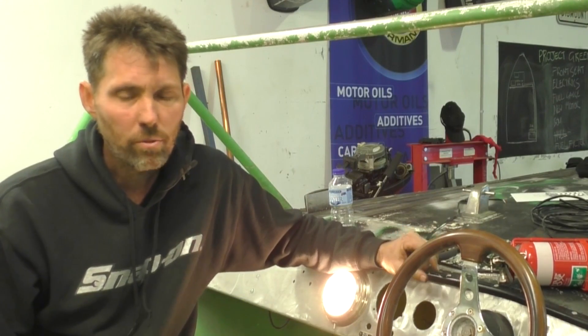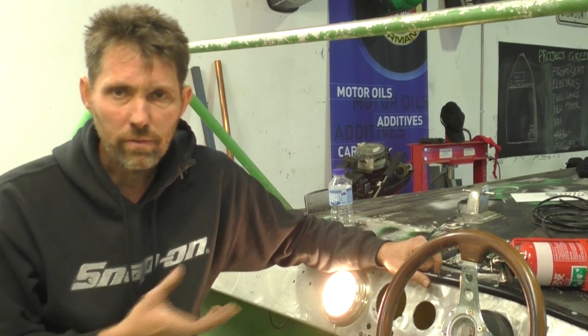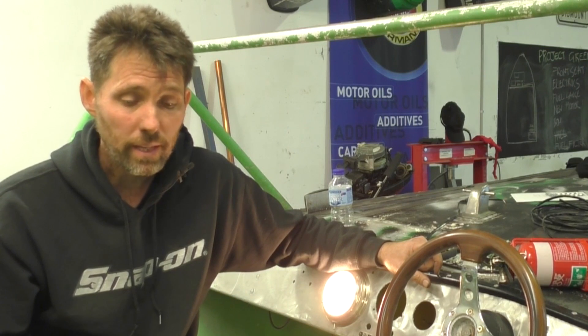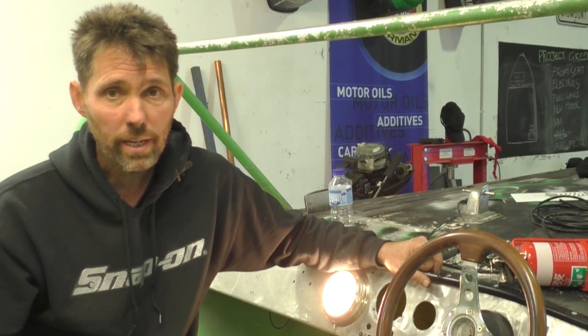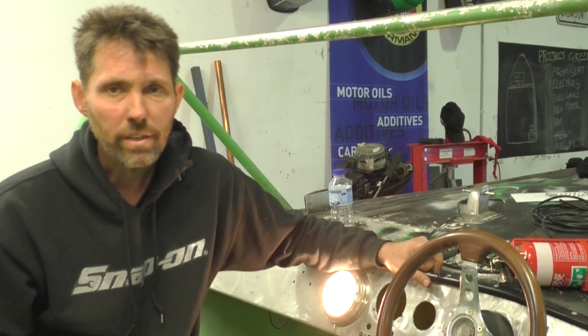Not the grandest achievement in the world, but we've got the backbone in. This is where taking a little bit of extra time to set up that infrastructure means that getting one thing online takes a little bit longer, but getting the second, third, fourth thing online is going to be really quick and the circuit's going to be much neater. I might go back and shorten some of those wires to reduce excess wire under the dash. Labelling is another great option - just putting a tag on a wire so you know it's your cabin light or whatever. These things are really an investment in the future. For mechanical protection, some conduit for that cable - I'm going to wait until I see how many cables I've got running fore and aft before I choose a conduit size and wrap it around the whole thing.